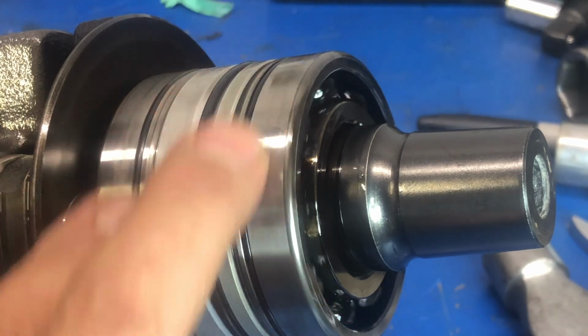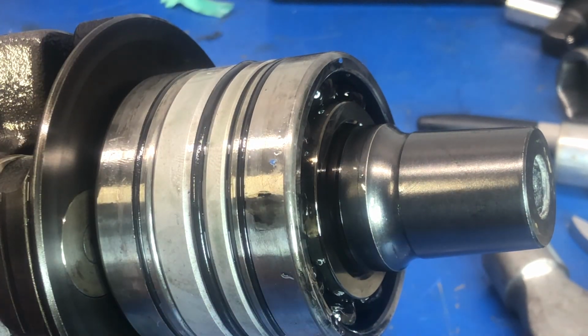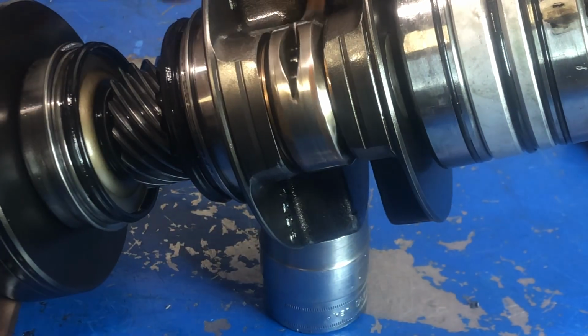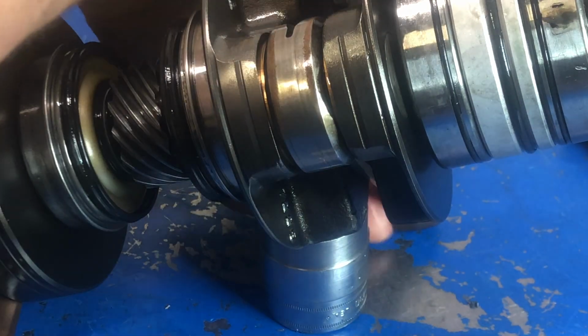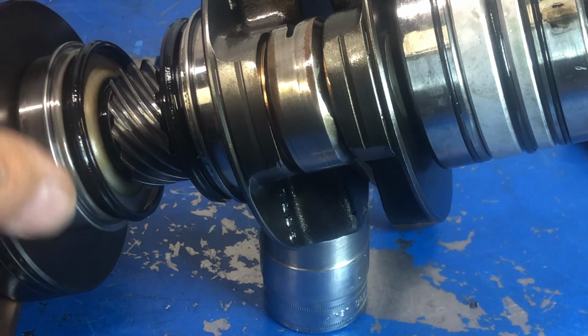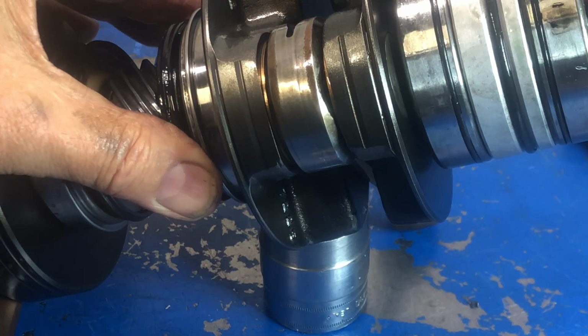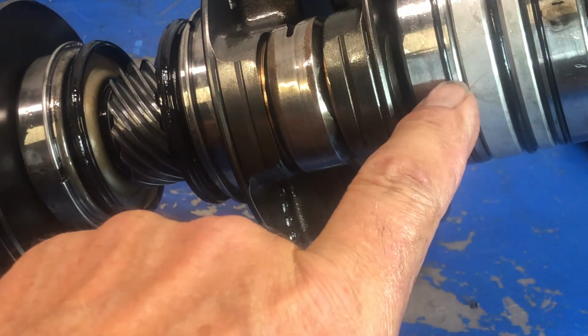So 2 bearings for here, proper clearance. But before that's done, we're going to need to make sure that the connecting rods clearance is salvageable, and we can use this crank again and have a look at some other items on it. So maybe we can save this one with 4 bearings if we put it all together properly.